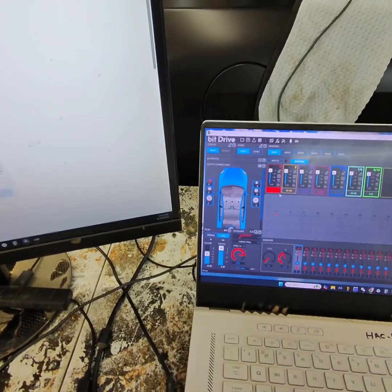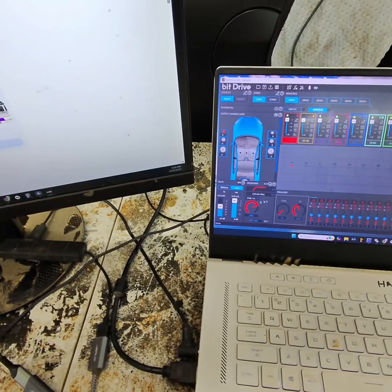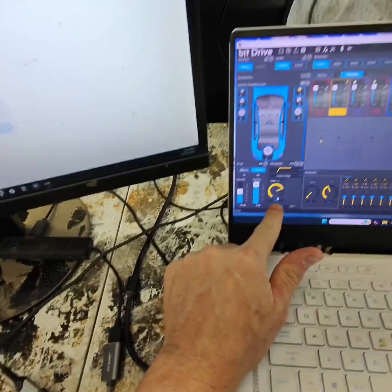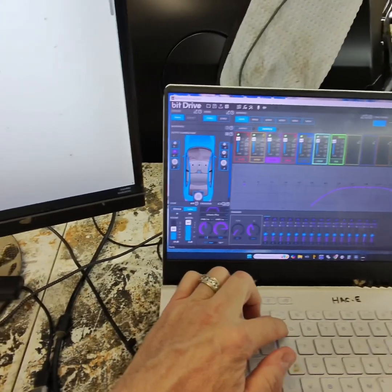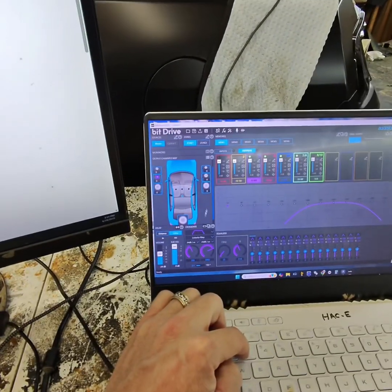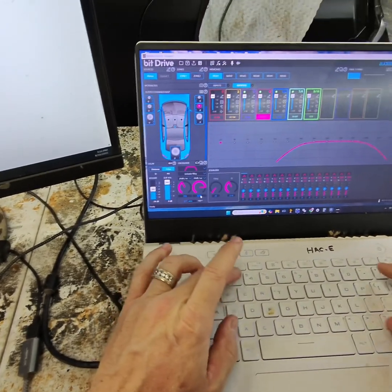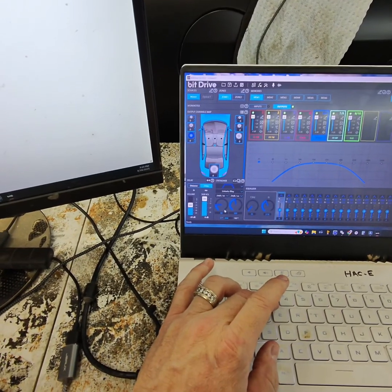All right, so we're gonna set this tweeter up, cross over here. We're gonna put that at 3,000 hertz and 24 dB per octave. Tweeter here, 3,000 hertz. Down here at the bottom, mid-range. We're gonna run that from 350 hertz to 3,000 hertz. Bam. Should probably sync these somehow. 350 hertz. 3,000 hertz. And then we're going to start these woofers at 80 and we're going to listen to them.